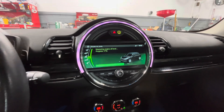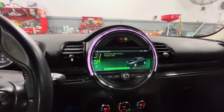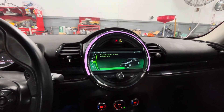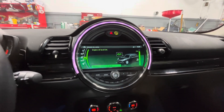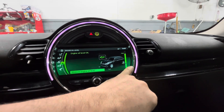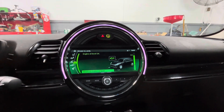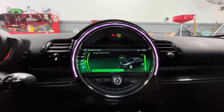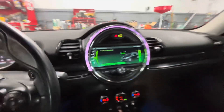This car was just in for an oil change, so that's what you have to do. It's not my favorite system, but all the other cars are doing kind of the same thing now — I miss dipsticks. After it counts down to 100 percent, it'll tell you the oil level. Here's your range — minimum to maximum — which represents about one quart of oil. If you're in the middle, add a half quart; if you're at the bottom, add about a quart, maybe a little less so you don't overshoot. That's it, thanks for watching.